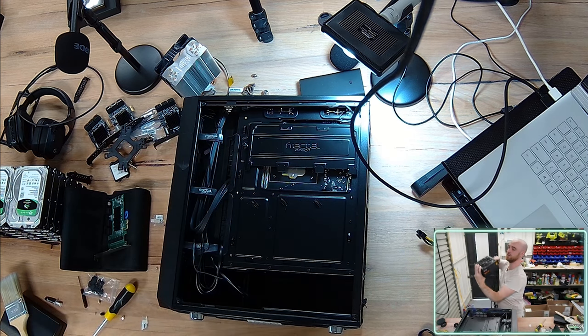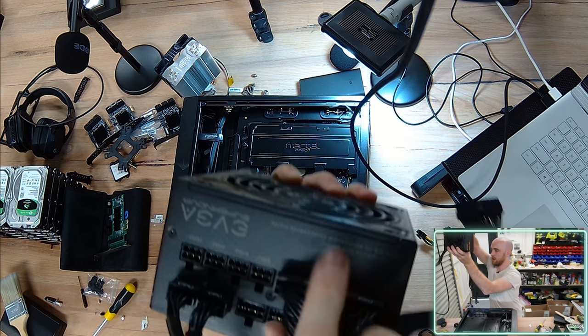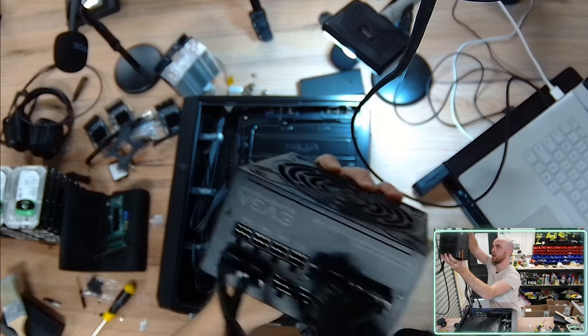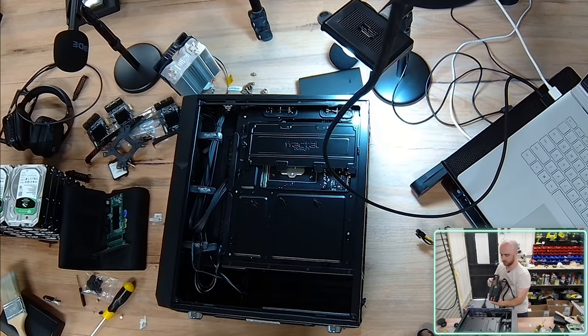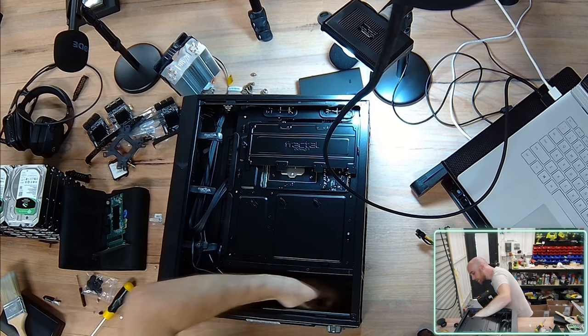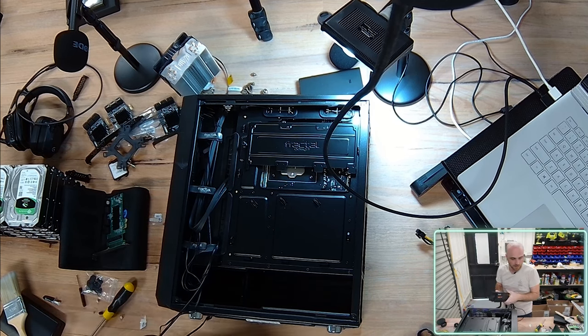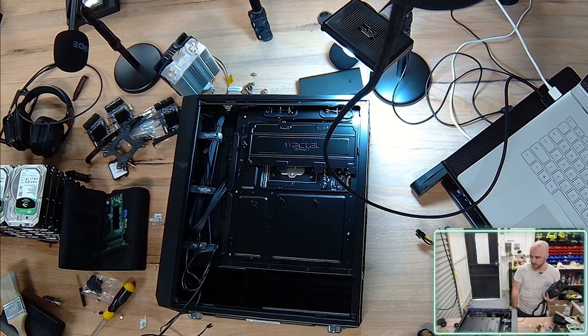Plug and play sort of slots. I've got my main motherboard cable connected, two CPU cables, and then I've got two GPU cables, which I need to connect and route all of these through. But yes, it's probably going to be a lot easier if I connect the SATA cables now rather than later, because once this power supply is sitting in there, it's actually quite difficult to access those modular components.